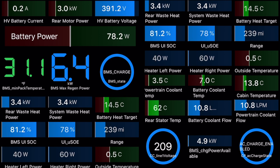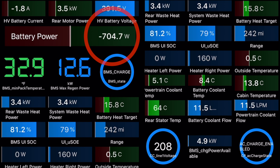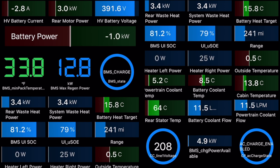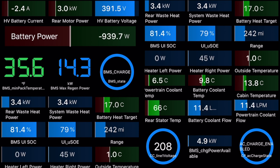Let's speed this up to eight times as we warm the battery just above freezing — watch that top-left corner with the battery current. Suddenly, there we go: it's solidly negative. We're starting to charge the battery. We went from zero to solidly two amps, charging away at almost a kilowatt now. If we waited much longer it would eventually turn off the motor heating and just charge the battery normally, applying all five kilowatts. But we've achieved warming the battery enough to charge, warmed the cabin, and most importantly brought back a lot of regen power that makes it much more fun to drive.